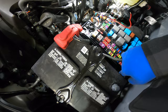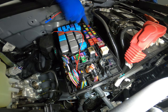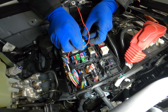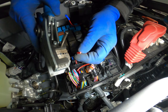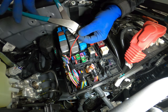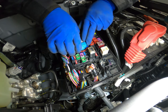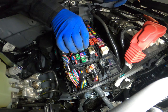With all of those connected, go ahead and put the battery terminal back on — get our negative back on there and tighten it back down. I chose to go with this last one here — it's basically one of the headlight ones. I'm going to keep it inside here. We can run it about that long and cut it about there. Get our strippers, install that, grab our crimper, crimp that on there nice and solidly, give it a little tug. Normally I would probably hit this with some tape or something like that, but I think it'll probably be pretty good inside this cover. I'll just lay this in here — I don't really think it needs to be secured down.